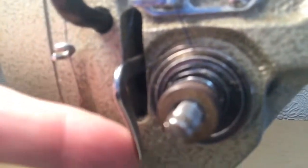Give you a good close-up view of all this stuff. And then the thread goes down here through this, and then around the tension. And then you see this little wire — the thread has to pull back and hook on that. And then it comes back down around this little hook here, and then back up through this piece. Then it goes through this hole — this is the part that makes the needle go up and down. Then you come down and it goes through here, and then hooks into here.